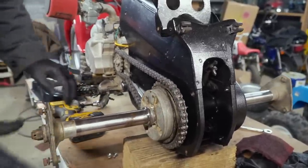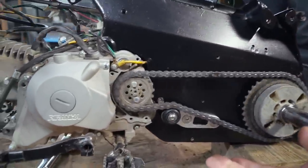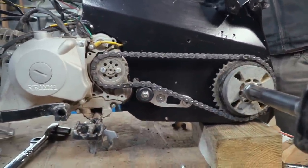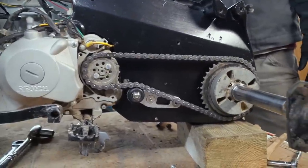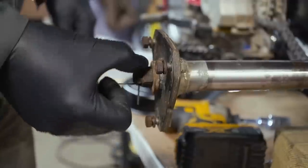All right. Looks like I'm redoing that. So we loosen the tensioner, and it looks like it just makes that noise, which is really disappointing. Once I take the tensioner loose, it doesn't make the noise anymore. So it is indeed the tensioner. I just hope it's not making all that noise while riding. Maybe it'll break in? I don't know. Yeah, a little disappointing.